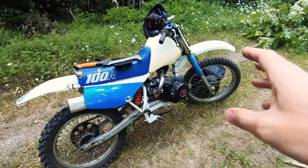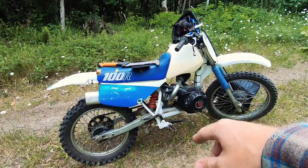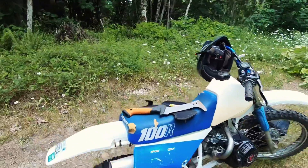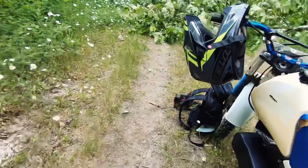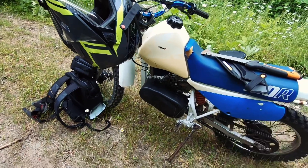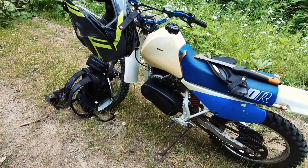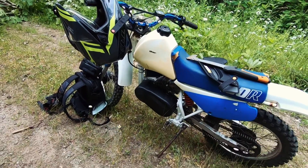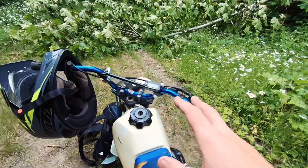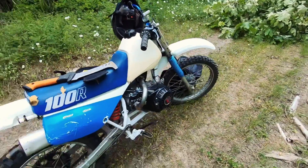Alright, got the XR100 chassis here with the Predator 212 motor. We've got a bigger main jet, the new intake, and the stiffer valve springs. Got the tach on here. I did a little work on the rear clutch spring — the number three hole, red spring. Still need to do more work: I need stiffer clutch springs to get the engagement RPM higher, and probably a stiffer rear spring too. On acceleration it's hitting about 4,400 RPMs — I'd like to get that higher, so it's going to take some more transmission tuning.